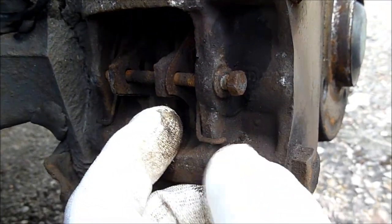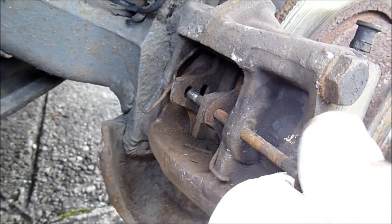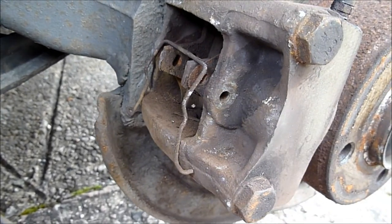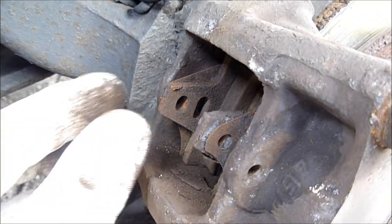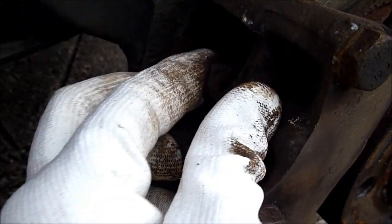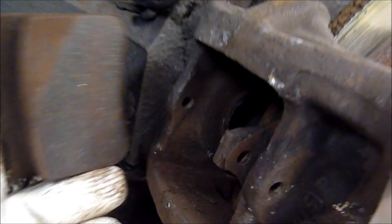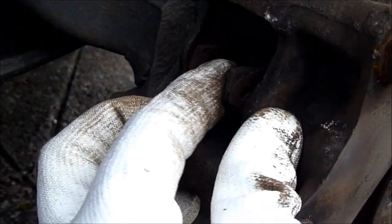So these are the springs. Removing the bolt now. And there's your spring. We'll push the piston back in a little bit, which will allow you to take your pads out. As you can see, the piston's out a bit, but you can push that back in basically with your old pad. Push them right back in with your old ones, and that's what you need to do to get your new ones back in.